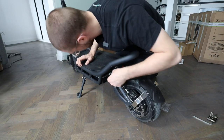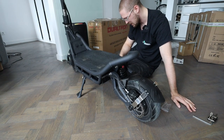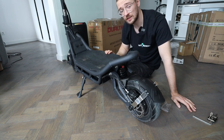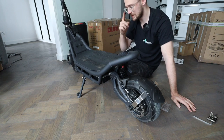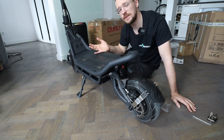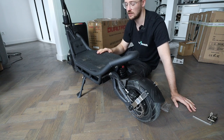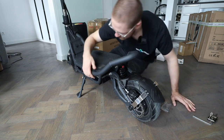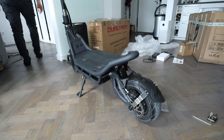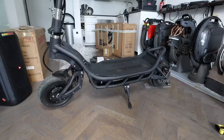A very cool solution here: the wiring for the back brake doesn't even go into the battery compartment. The battery is a 72 volt 35 amp-hour pack — around the same size as the 011X — however these are Panasonic cells, which in my eyes are better than the LG cells in the 011X. It also uses good copper material for the connections between each battery cell. These are details you don't usually care about when buying a scooter, but it shows the parts selection and manufacturing are on a high level. Around the scooter there's also an LED light strip with many more diodes than usual.